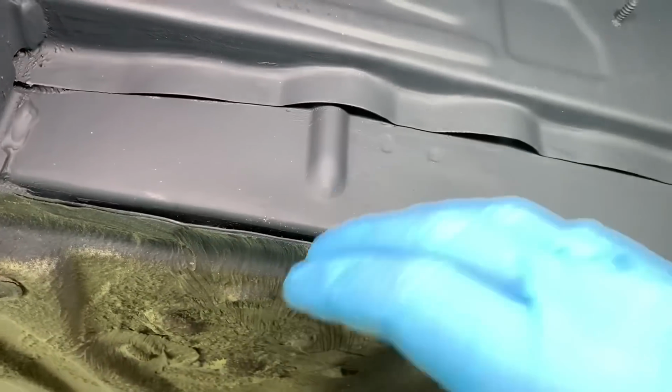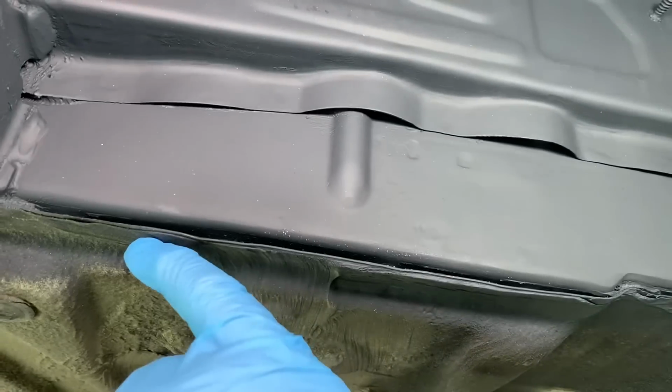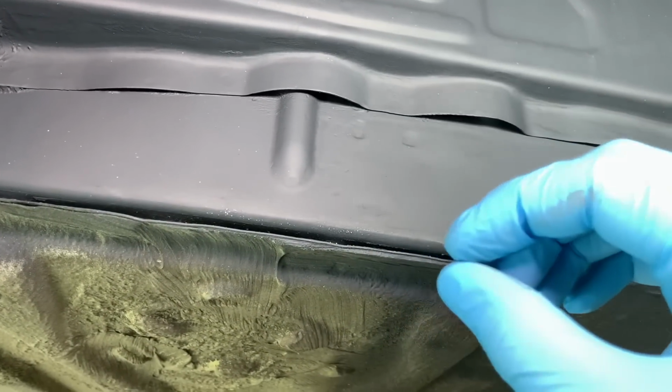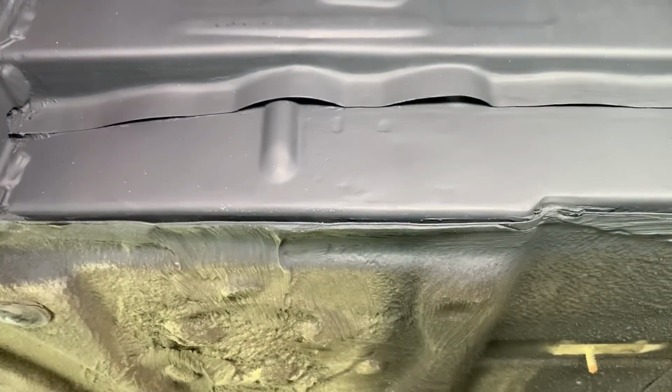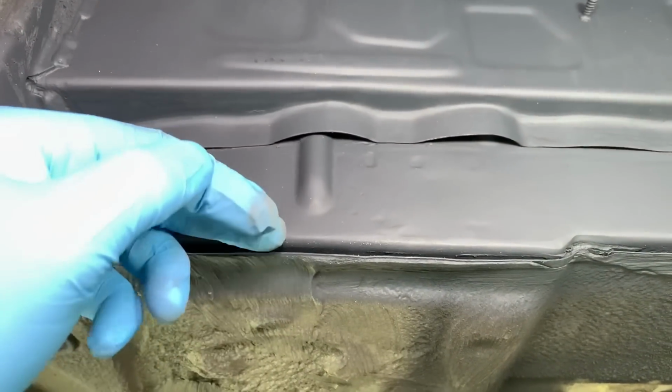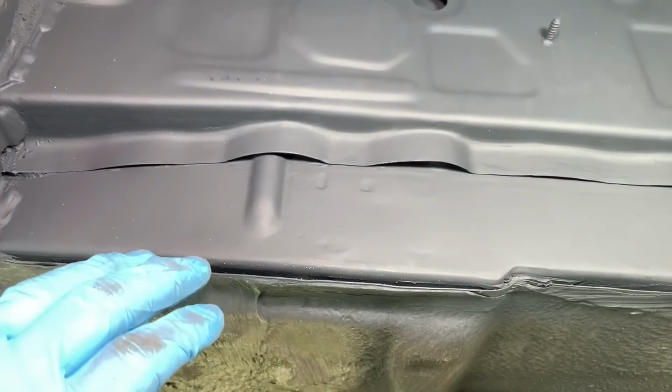The seams between the floor panel and the rear bulkhead, sort of rear seat, fuel tank area panel, those ones are breaking through with corrosion. You can see little lines of corrosion sort of bursting out of the seam sealer where the panel overlaps are, and that's just all down to trapped corrosion. So we're having to take more of that sort of stuff out, slightly tease open the panel, dig it out with picks, treat it as best as possible.